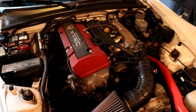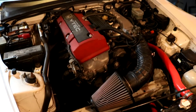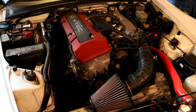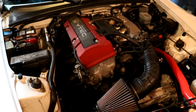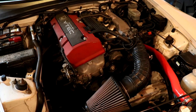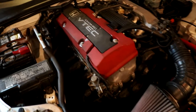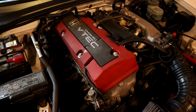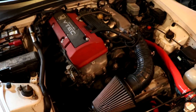The AP1s have an F20C engine which is a 2 liter, redlined at 9000 RPM like the gauge cluster shows. But this one - it's an F22. The previous owner bought the car with a blown engine and decided to put an F22C in it, which is the 2.2 liter. Same horsepower in the 240 range, but about 10 more torque. The engine as it currently sits has about 55,000 miles on it, which to me was very attractive. AP1s have that retainer issue where the valve retainers underneath the valve cover are known to crack and drop a valve and blow up the engine. This doesn't have that - it has upgraded internals. From what I can tell, it doesn't burn any oil, at least that's what the owner told me.